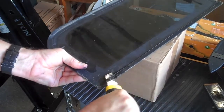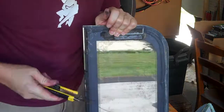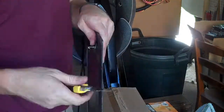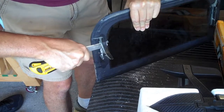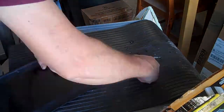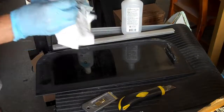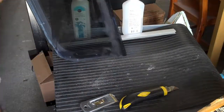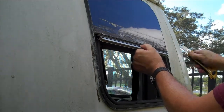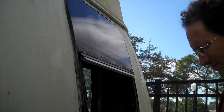Hopefully this razor knife will get a decent amount of it. There was a lot of leftover glue on the glass, but luckily most of it came off using razor knives — remember to cut away from your body. I really recommend this flat style razor holder for thin residue. I found that acetone wasn't needed and 91% rubbing alcohol was plenty to clean the glass. I also had to scrape the glue off the surface of the hinge, using a piece of aluminum to hold the hinge surface away from the rubber gasket. After scraping, I sanded it to get the last little bit off, then cleaned the surface with rubbing alcohol.